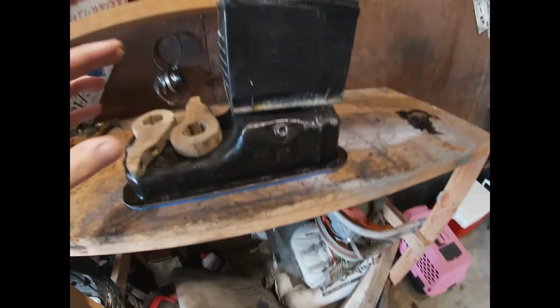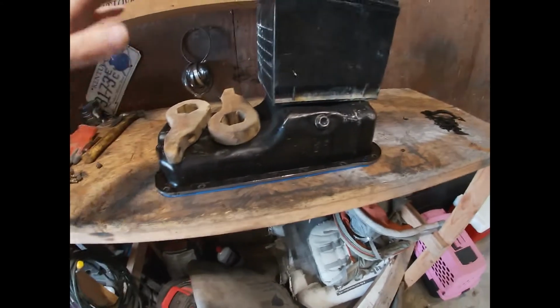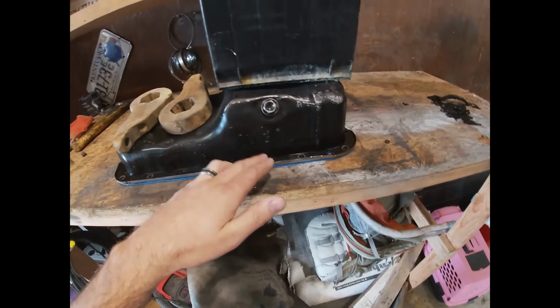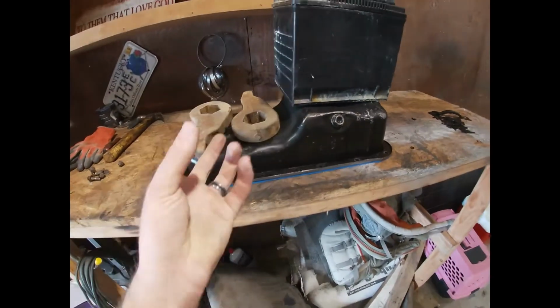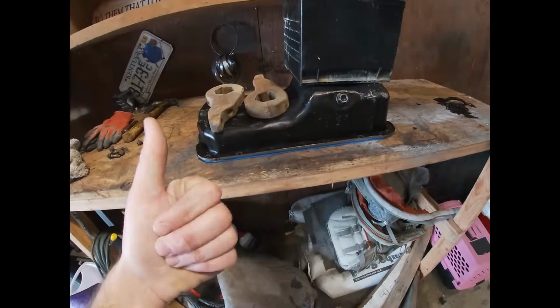And then for the last 2 days, I've had a battery and some torsion keys from my Suburban weighing this thing down, so hopefully it's dried and stuck the oil pan gasket to the oil pan, and then I can flip this thing around, mount it under my engine, and then we'll be good.